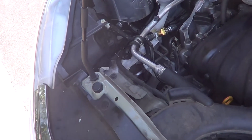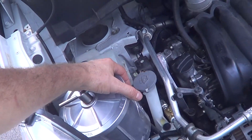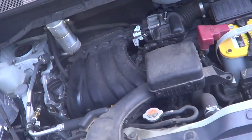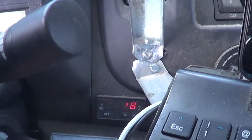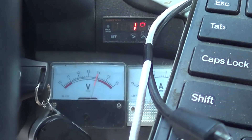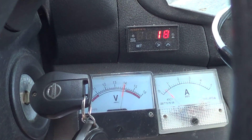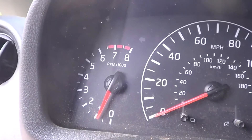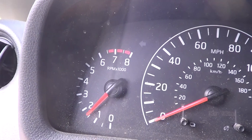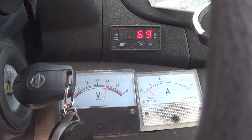You can tell when you've got the flow because it's smoking hot — the oil runs hot in the engine. So let's look at our idle and our 3000 RPM pressure. I tie it in on pressure to the pressure transducer. At idle, it's about 18 PSI, which is about what I had before. And then at 3000 RPMs, it's about 70 PSI.